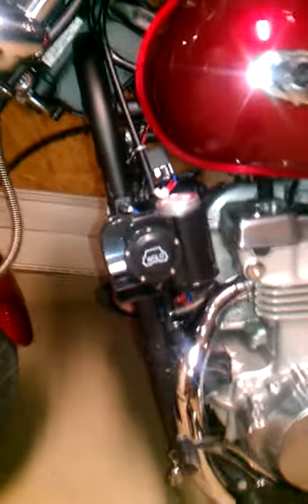Take the existing horn off of the bracket, flip the bracket around, take the metal grommet out, and that'll be the perfect spot to mount the new air horn. It does have a bolt that it hangs on, and I put an extra couple tie wraps in there in case it tries to shake its way off. But it is tight, and I'll go for a sound test now.